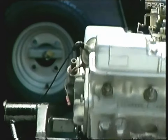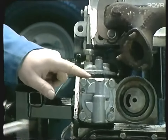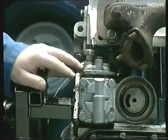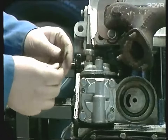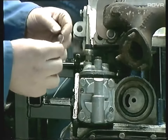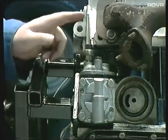If we have a look at this engine on the engine stand, we can see more clearly the oil pump and the oil transfer housing. Check these areas carefully - they're sealed with O-rings. Now over a period of time those O-rings go brittle and stop doing their job, breaking up very easily and causing the engine to pour with oil.